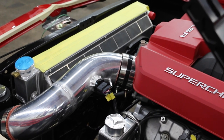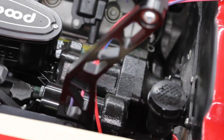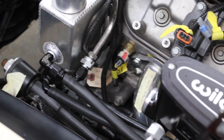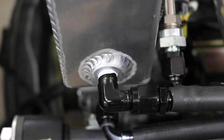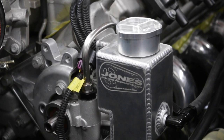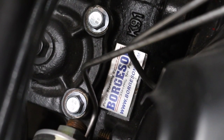The CNR units are nice — we've used them a lot with good success. Brake-wise, you can see the Wilwood master and the Hydro Boost unit. We've got a CPP Hydro Boost unit and a Jones Racing dual-port reservoir so we can run the Hydro Boost properly without having to tie our return lines together, which keeps everything flowing better. If you don't have an extra port on the original reservoir — which is plastic on a lot of these cars — you can put a T-fitting, but sometimes that doesn't flow well and you can feel it in the pedal and get some power steering noise. We've also got a Borgeson box on this one.